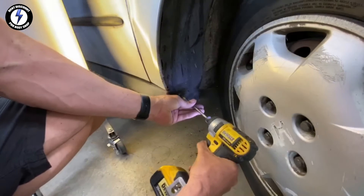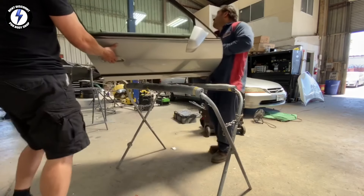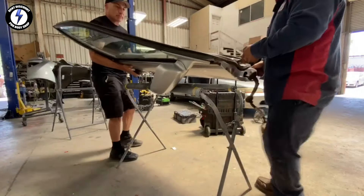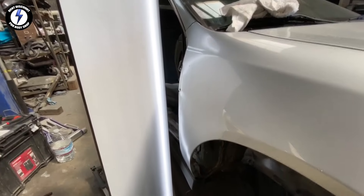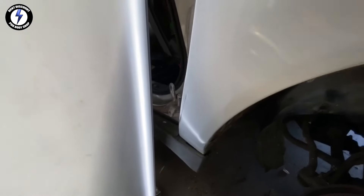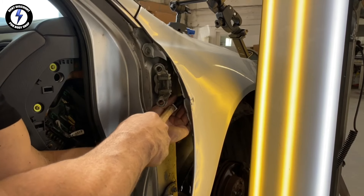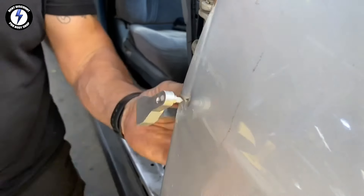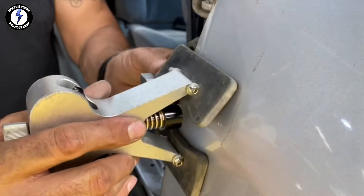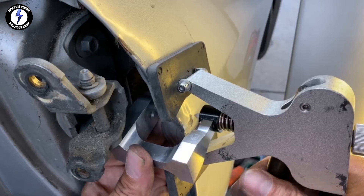Using my impact drill, it's time to remove the fender lining, the wheel, and the door. Here is another view of the fender — we are making progress. Using the head of the hammer and hooking it to the back side of the fender jam, we are pulling the jam toward the door opening. I am running my PDR edge tool behind the panel and sliding in my mini lifter to hook it in place to the edge tool — this is how I remove dents from behind the door jam area.